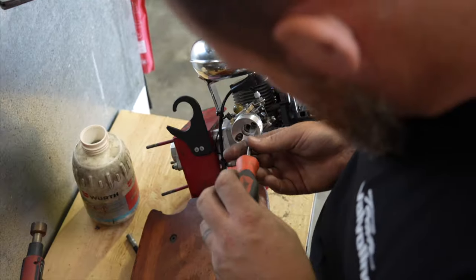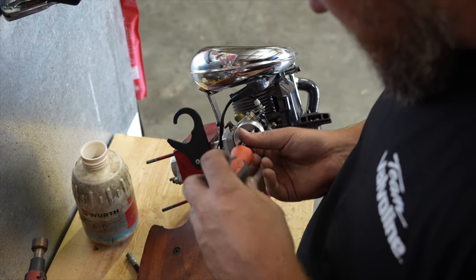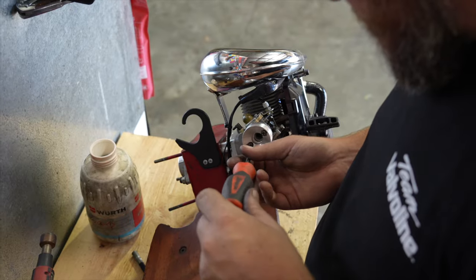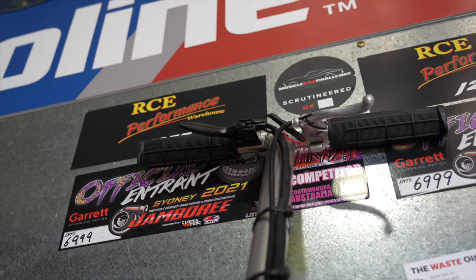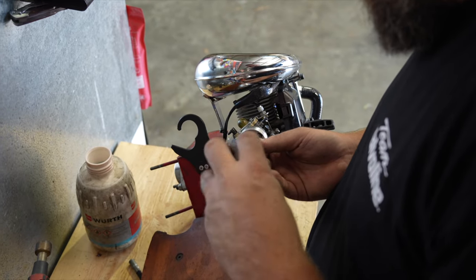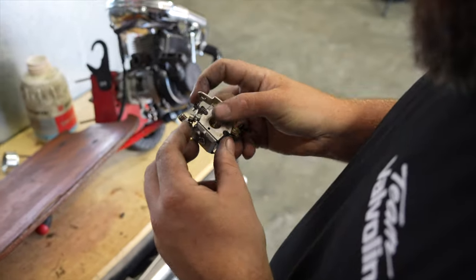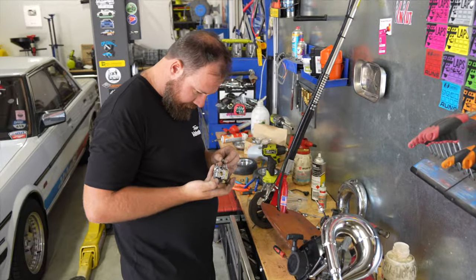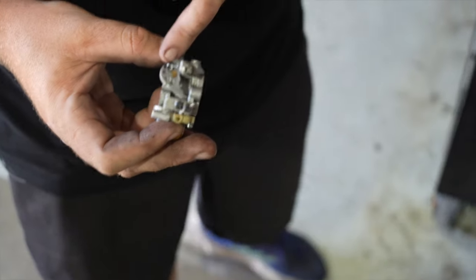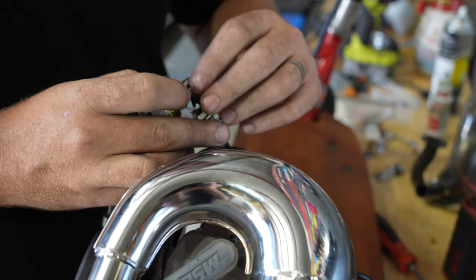I'm going to take the carby off. I just want to look at the way that throttle linkage is set up, because I think there's different holes and you can actually change the ratio of how the throttle works — effectively shorten the bell crank. At the moment you hit full throttle in the carby way before the throttle linkage tops out, so you're kind of bending the mounting bracket every time you go full throttle. You can't move it because the hole's been drilled out — that's not standard. That's annoying. I'm just going to chuck it back together.